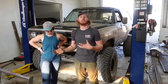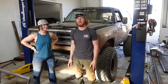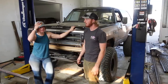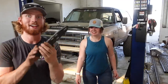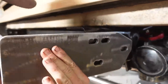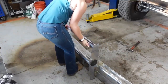There are some parts of the old bumper I want to put into the new one — the bull bar — I think we've got to keep that. But we have to make a winch plate and tie it into the frame, strong enough to hold the winch and more importantly to hold the entire weight of the vehicle off of it if we have to — like off a cliff. Just like on the rear, I think we should have a plate go into the frame and build off of that. Surprise — I built the plates already, and I've got these holes lining up with holes that were in the frame previously. I added my own for extra strength.